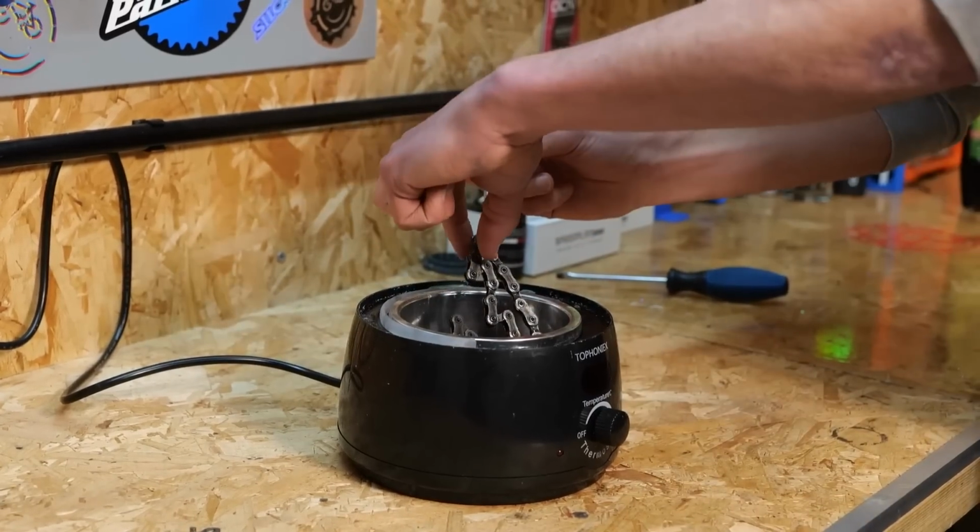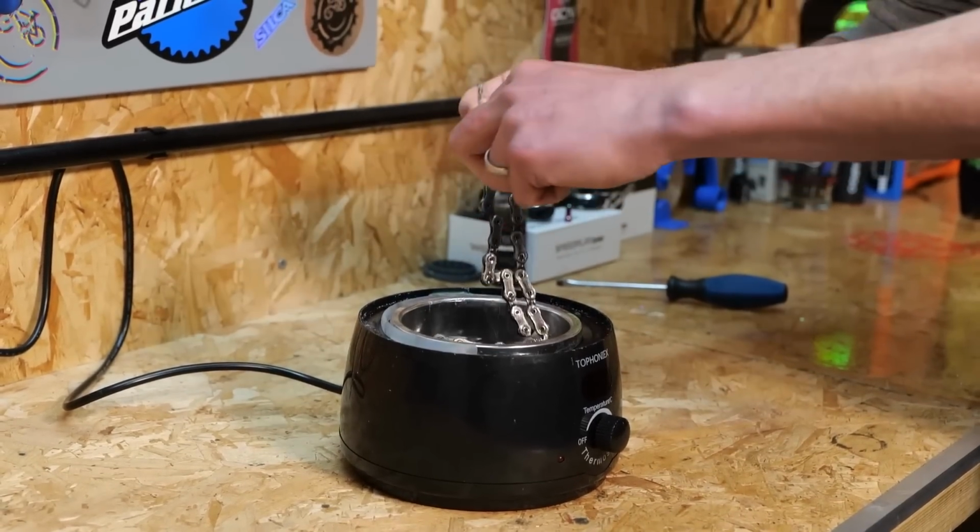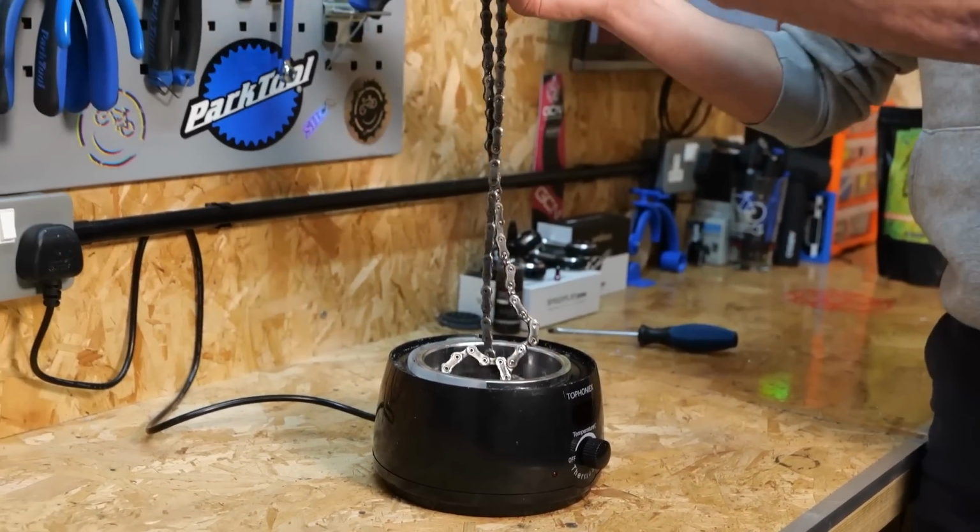You can actually get waxes from fats, similar to a soap, and that was being used to lubricate those chains. So as we fast forward to modern times, the real advantage of wax lubricants is that they are solid and non-sticky. We're getting dirt and dust landing on our chain, and we don't want it to be sticky so all that stuff sticks onto it. A solid lubricant like wax can run much cleaner than other types of lubricant.